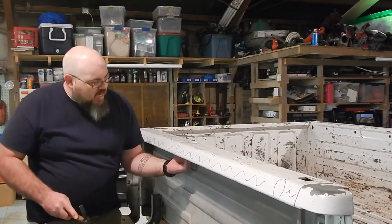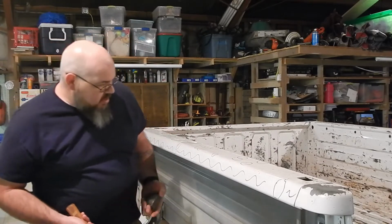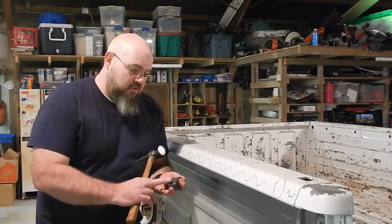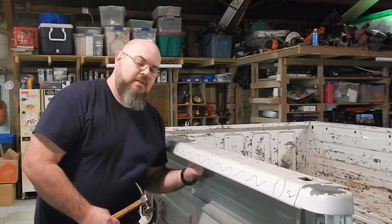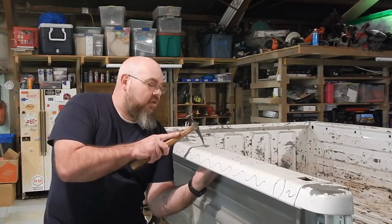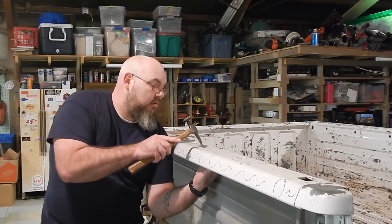And that's another thing, guys, when you're working a dent, if you can't get in there and swing that hammer, but you can reach your dolly in there, you can actually push it up with the crown of that dolly. Just hold it in your hand and put that directly on the dent. And if you can push up hard enough, then what you'll actually do is bring down the other metal that you're bringing up with it, because you're pushing that dent up already, and now you just want to knock everything else down.